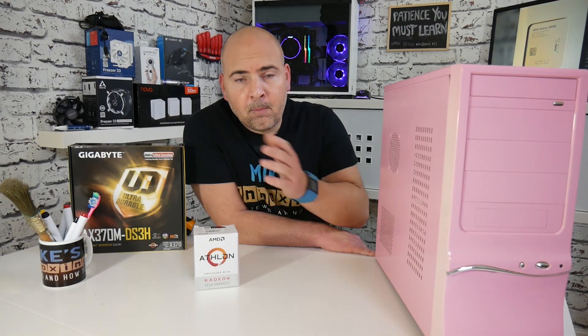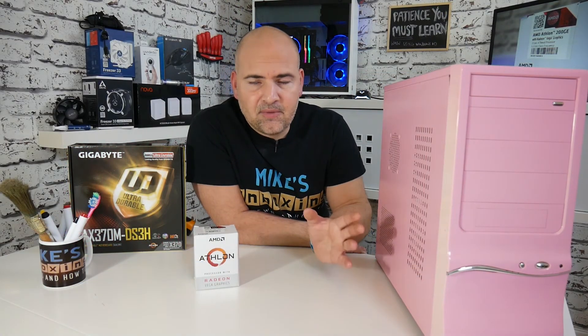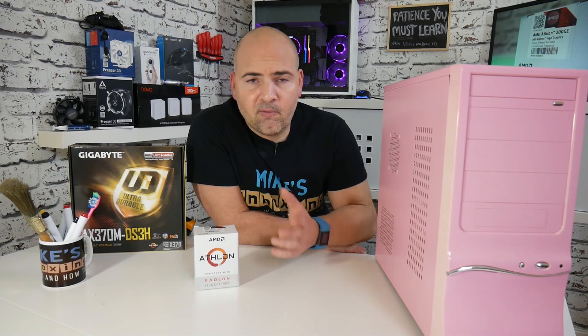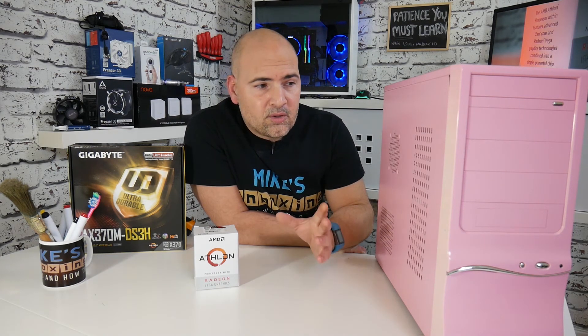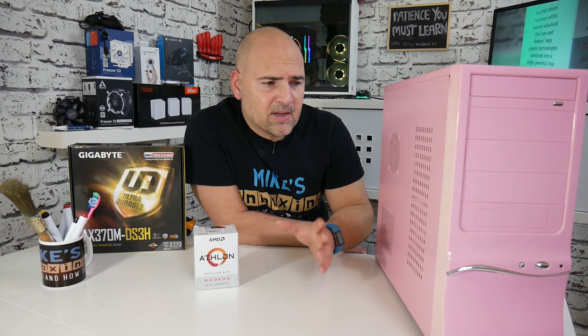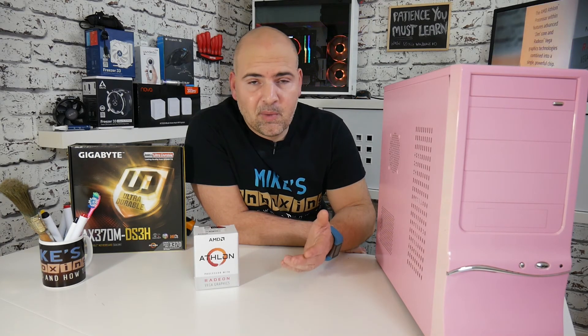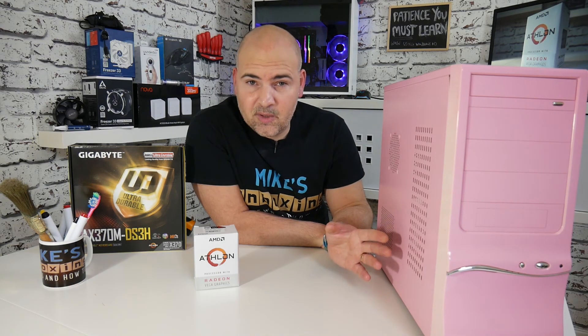Obviously we've got this motherboard as well. Now originally this system started out with 8 gigabytes of DDR4 RAM, which was the Corsair Vengeance LPX at 2133MHz — that was a single 8 gig stick. Ideally this needs to be dual channel; there is a 10 to 15% performance increase overall and it also feels a little snappier if you're using two sticks of RAM. So I've borrowed another stick of RAM and at the moment it's in 16 gigs to make it dual channel. I would still recommend 8 gigs because of pricing — if you're spending 100 to 120 pounds on RAM, a 50 pound processor isn't the best mix for that. So 8 gigs of RAM is the sweet spot for this kind of setup.